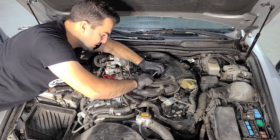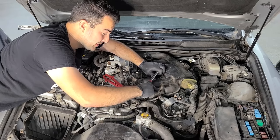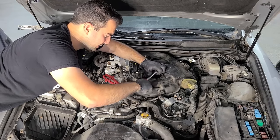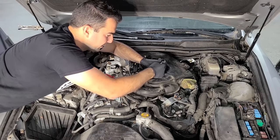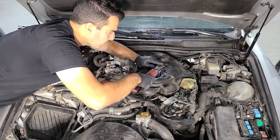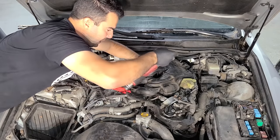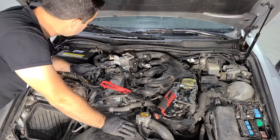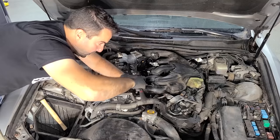And now, do one of these, and these are not torqued very high. I don't think they've ever been off. These intake valves might be kind of dirty. Yeah, we just want to be gentle. Whew, these can feel a little bit weird coming out, I'll tell you that much. All right, so don't go ahead and use impact tools or anything like that on these until they are loosened up by hand. Very, very important.